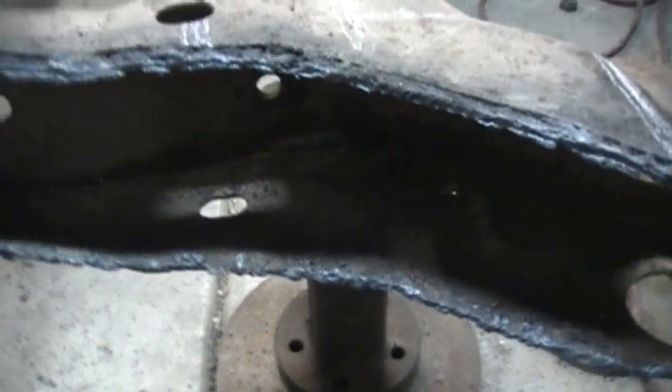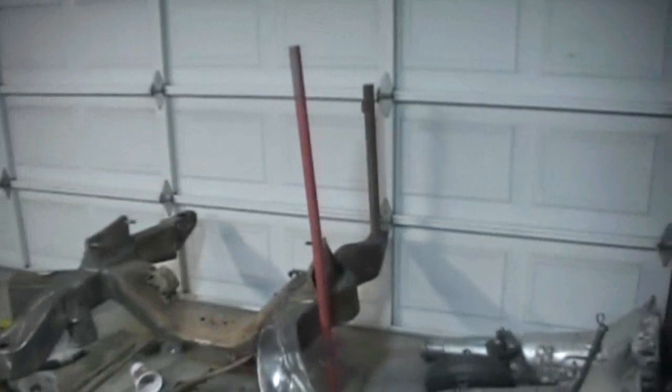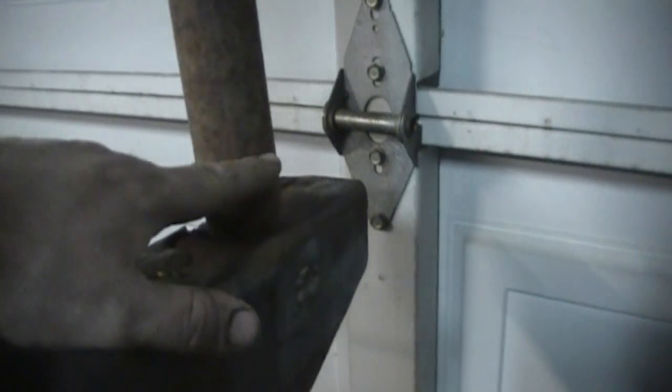Give me your opinion on that. Then I'll just have one whole piece along this edge, inset a little bit so I can weld it all the way down and fill all these holes so you don't see anything inside. The question is — you can see that pipe up there going through. I plan on doing this near a lot of the body bolts, two reasons: the frame horns will go on this and I need it up against that. As I'm thinking about it, I'm considering putting a washer inside this, because the frame is angled and you can't get a good grip on a bolt. So I'm thinking about welding washers or pieces of tubing inside as best I can.